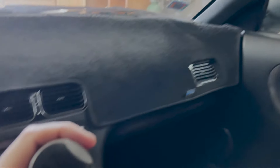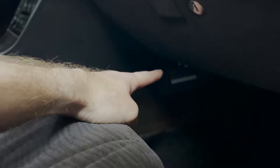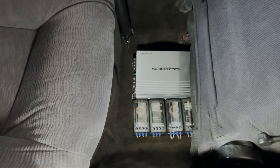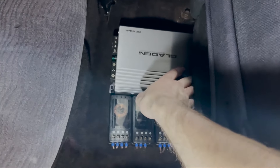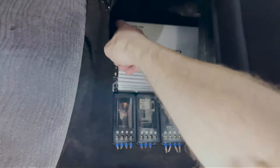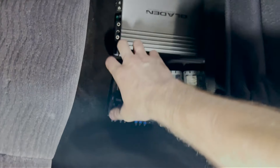The same will happen on the other side. Cable management-wise, I think I'll install the amp and crossovers behind my seat and route the cables. I can draw all the power from the bus bar box I've made. It's a quite short run to the back of the seat. I'll need to find a piece of wood to bolt everything down so it doesn't slide around and keep the power cables away from the seat rail so it doesn't short out. I'll route everything around behind the center console. I have almost everything — I just need RCA cables, so I'll take a quick trip to the shop to get them.